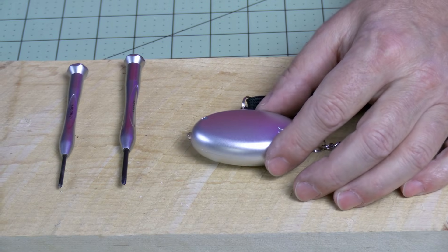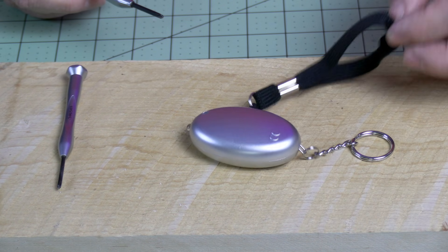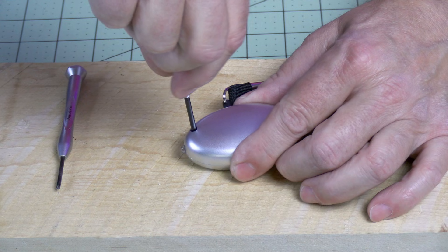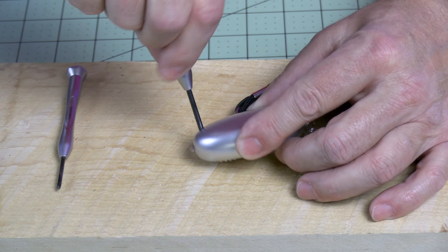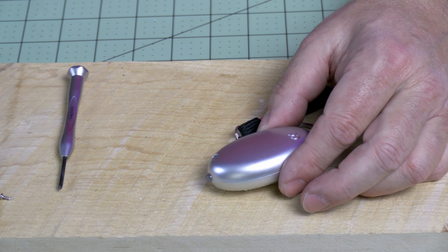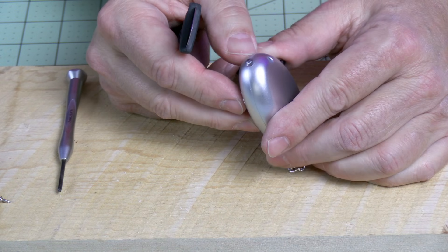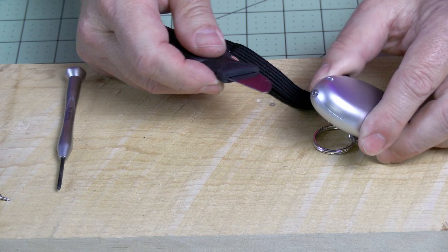The first thing we need to do is remove this small screw right here, and be careful you don't pull the pin while you're working on it or you're going to have a bad day. So I'll take the screw out. It does have a light that's built in — we won't need that. Then the next thing we need to do is pry it apart. Sometimes it takes a little effort, but just try to find the most likely place that you could pop this apart. I'm going to try where the light is mounted and see if that works.